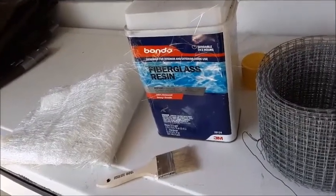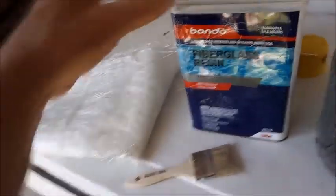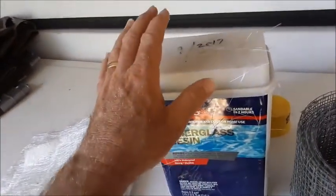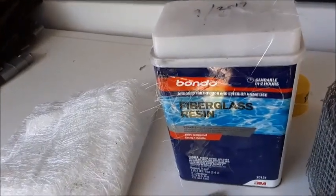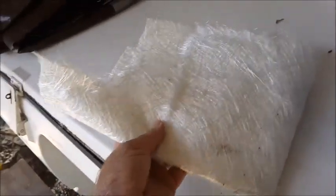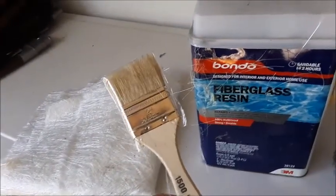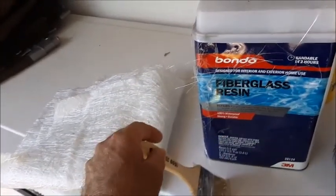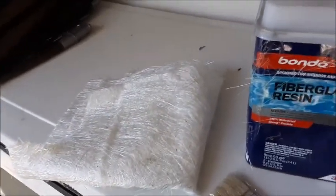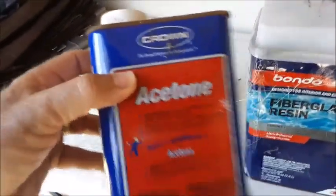You'll probably want to use a combination of several different products to seal up your pop-up camper, all of which are available from Home Depot or Lowe's. The first item is some fiberglass resin — you pour it into a container, mix in the hardener that comes with it, and it will dry rock solid within about 15 to 30 minutes. Use that in combination with fiberglass cloth, cut to the shape you need, and apply it with a disposable paintbrush dipped into the mixed resin. The fiberglass mat actually becomes transparent. You'll want to use disposable latex gloves because the only thing that will clean it up is acetone.